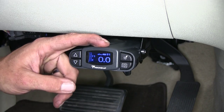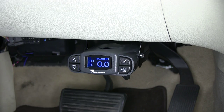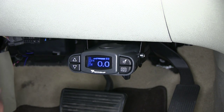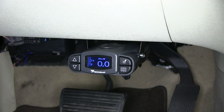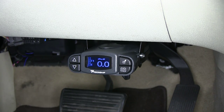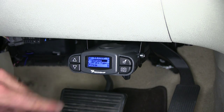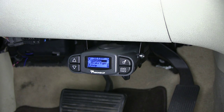Another nice thing is going to be our boost levels. The boost levels are going to set the initial power and aggressiveness in which our brakes come on. Boost one would be for a lighter trailer. As we move up through our boost levels it goes to bigger and bigger trailers, and we can even set the boost off if we've got a light unloaded trailer that won't need that immediate response. The unit also has setups for the display, brake type, and help menus, and it has five storable settings for different trailers, drivers, or conditions.